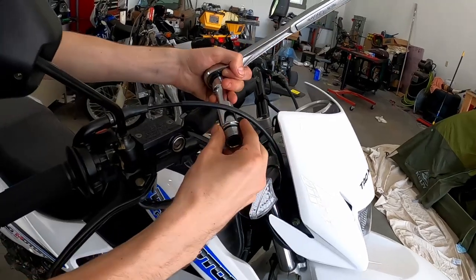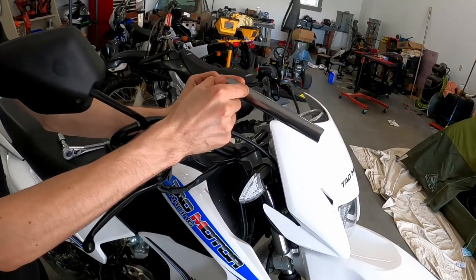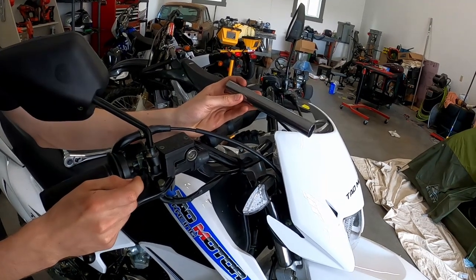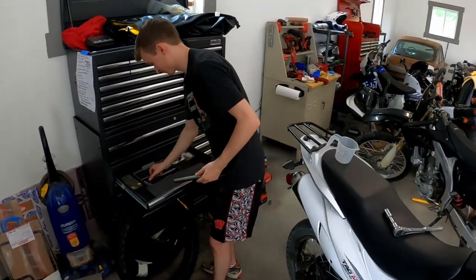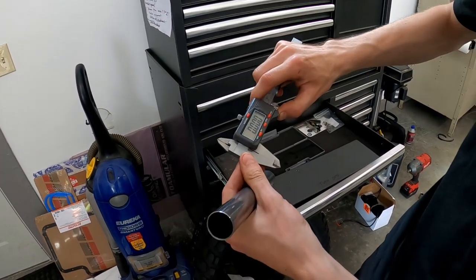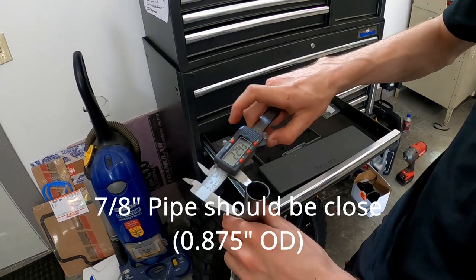There we go, spring force popped it out. I've got the cap, then you can pull your preload spacer out. I've seen some videos of guys with the Tao Tao where their preload spacer is like an inch long — apparently that's a factory error; they're supposed to be about seven inches long. You want to check that, and if you don't have the right size, either buy the correct one or get a piece of pipe and make your own. Let me measure the diameter — it's about 0.907 inches outer diameter, or about 23 millimeters.